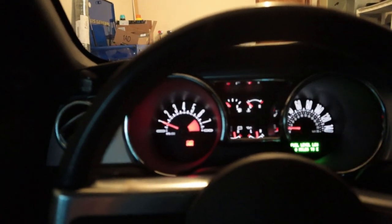It's the next day now. Last night after uploading the tune I went on a test drive — I didn't record much because I was losing daylight. I did a couple of pulls and the car feels a little bit quicker. The most noticeable improvement is that the power band is a whole lot smoother. With the stock intake it was boggy down low, would pull okay in the mid range, then droop at the top end. Now the torque curve is much more linear and it pulls harder all the way to redline. Also, with the cat delete and stock intake I was averaging about 16 mpg, but on the test drive I got the car averaging about 20 mpg — even while doing hard pulls, which is awesome.